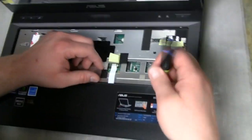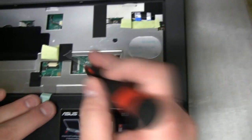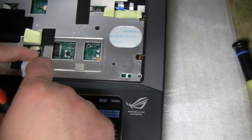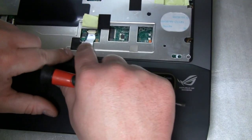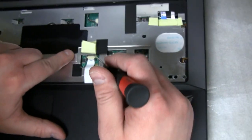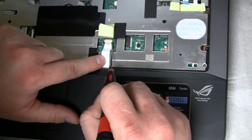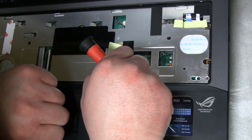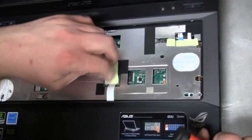Now that we've got that plate on, we're going to get the touchpad ribbon back into place. Make sure both little clips are pushed forward as far as they can go in the unlocked position. Position the ribbon so it slides into place — it's got a lot of pressure pushing against it. Once it's in there, you can see the block line is lined up. Lock it into place by pressing both sides until it's completely locked down. Give it a little tug to confirm it's not going to move. Now put the tape back down to tape it into place.